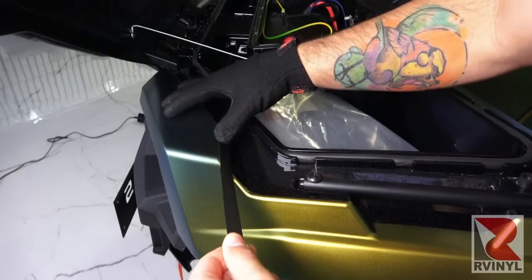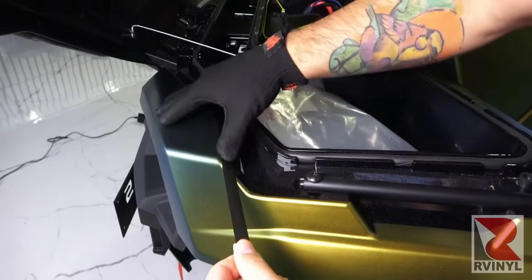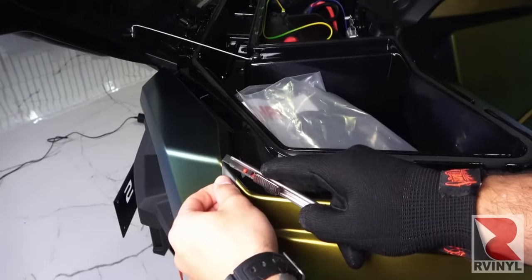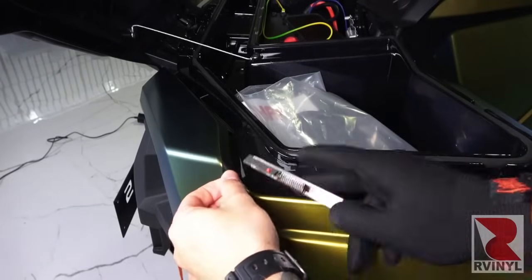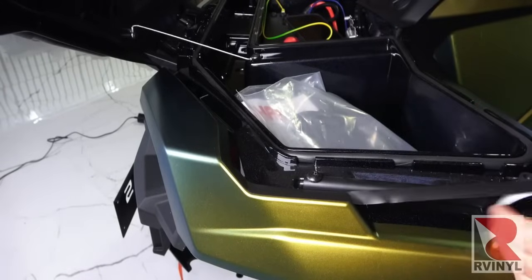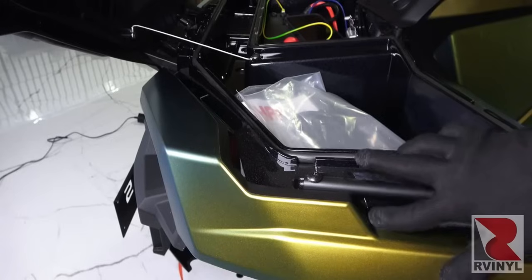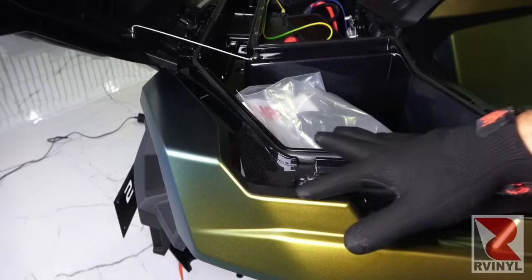And one very good finishing tip for ATV wraps is, because they're exposed to a lot of wear and tear, there's also a lot of exposed edges, and the surface energy is plastic, coming in with a strip of black film, half on the wrap, half on the plastic. This will help seal the edges and hold any overstretch on these really complicated curves and recessed areas.